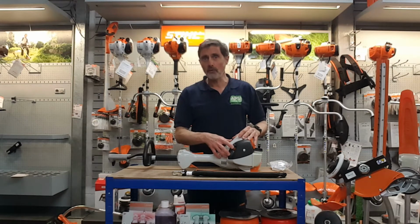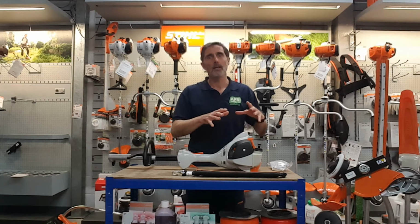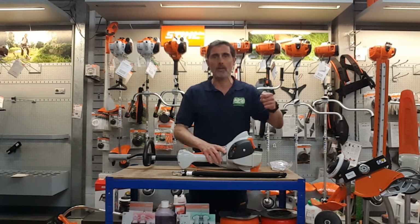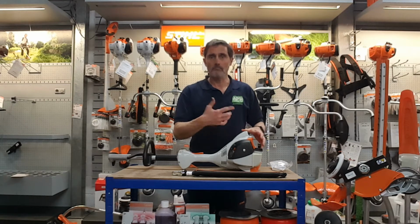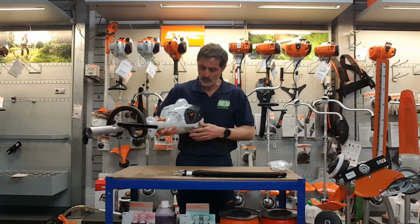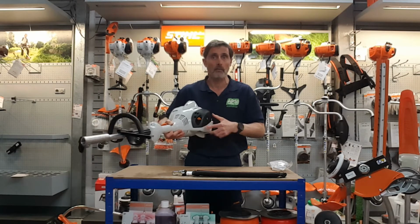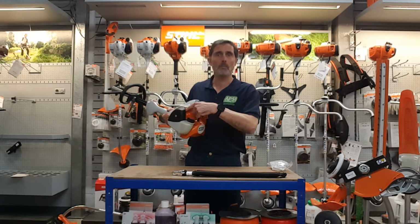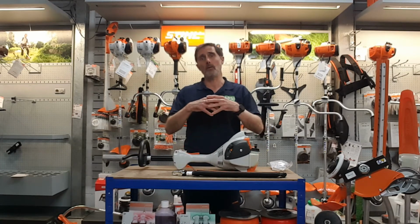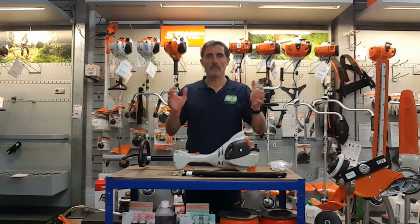So going back to the choke, when you've got it in full choke, all you want to hear is a cough. Sometimes it might just catch and then pitter out after a few seconds. Don't think, oh blimey, I'll go back and try and start again. All you're going to do is flood the carburetor. Once you hear that cough, or it's pittered out after a few seconds, push the choke lever to half position, half choke, and do the same procedure again. Press the primer bulb and then pull the recoil, and then the engine will catch. It'll go at 70% full revs, and then once it's warmed up after 5 or 10 seconds, perfect.